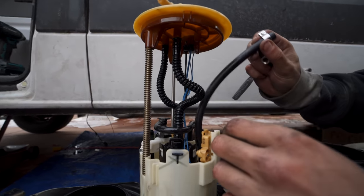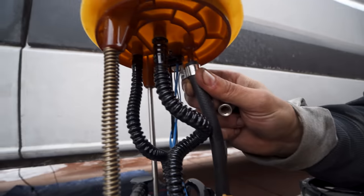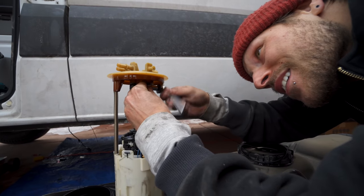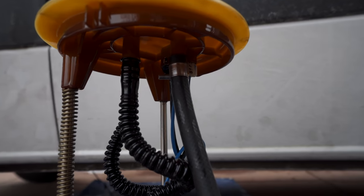Then it's on to installing your auxiliary fuel line. You'll find a nipple with nothing attached to it. So snag yourself about 9 inches of 1/4-inch hose, attach it to the bottom nipple with a hose clamp, and this is how you'll be getting the fuel from the tank.